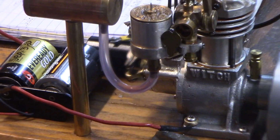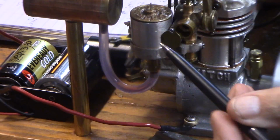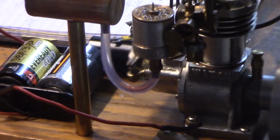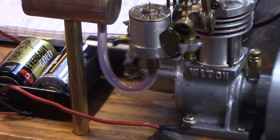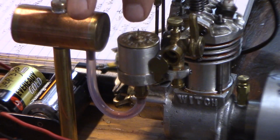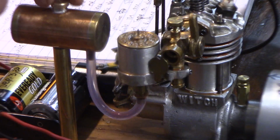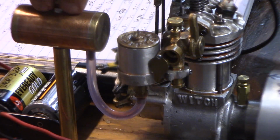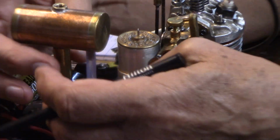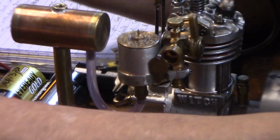This particular engine, this old engine, had a carburetor float valve made of a cork. When there's fuel in the float here, in this little tank, it's a little float tank, like a Briggs & Stratton. The needle that sticks into the float, you'll be able to push it down and feel it pop back up, like that. So make sure you're getting fuel. Make sure the fuel line isn't constricted, twisted, pinched, hooked up. Check the fuel tank. Who knows? Maybe it all leaked out when you weren't looking.